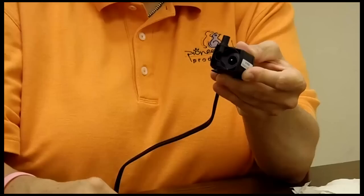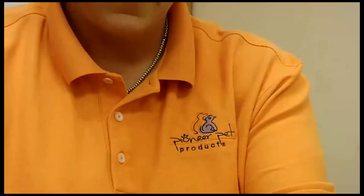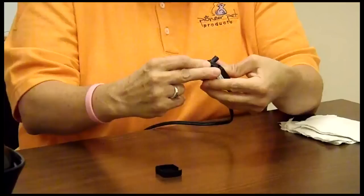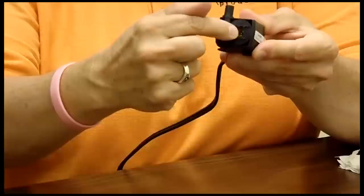Once that's all cleaned out, you also want to wash off the impeller. Make sure that the magnetic piece — or the metal piece — is all cleaned off. Clean off your base plate and clean off the cover as well. Then you simply put this back together. The stator goes right on top. The stator has the switch — you want this switch all the way open, if you're looking at the pump underneath the spout. This opens up the flow hole so that the water goes into the flow hole and will pump through. Then you put the face plate back on.